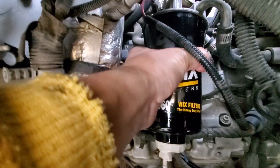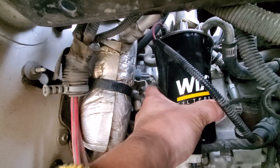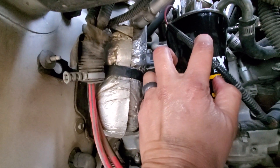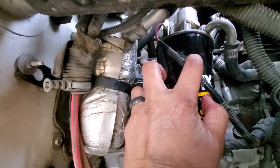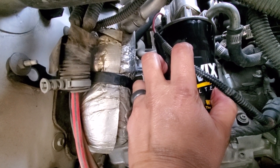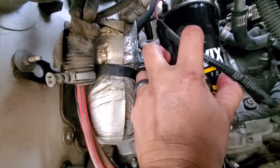Get it nice and hand-tight — I don't want to do it too tight, just like an oil filter, otherwise this plastic will crack. I'm going to date the day I put it on, mark it right here — the day of the fuel filter swap. I think it's every 10,000 miles they say to do this, though most vehicles will have a gauge showing the percentage. The cool thing with putting fuel back in here is you don't have to prime it as much.